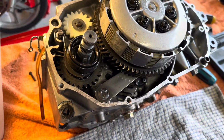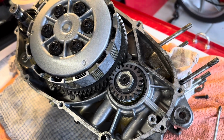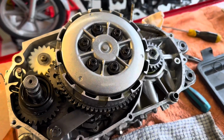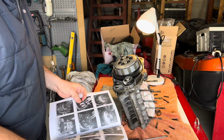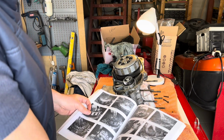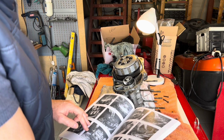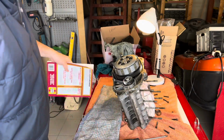Looking very clean and tidy in there. I'll just take a couple of photographs just to remind myself of how it all goes back together. I have got the proper clutch tool. I've just been consulting the good book, and verily, once the outer cover is removed, thou shalt take off the clutch by releasing these springs here. Then, once the clutch plates are removed, put into gear, lock the gearbox and remove the nut which lies beneath. Okay, let's crack on.